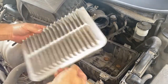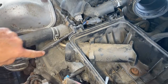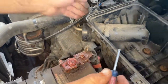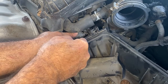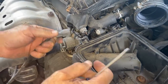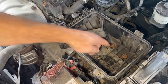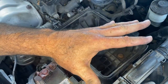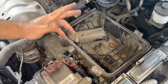Remove the air cleaner, which actually needs to be replaced. As you can see, this is the plug-in and it goes all the way down to your oxygen sensor down there. There's a tab on the back — just push in that tab and pull it out. That's all you have to do to release that little notch. If it doesn't pop out as easy as this one, you'll have to take these three 10mm bolts out and remove it that way to give you a little more room. But this one popped out easy, so no problem.